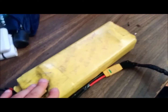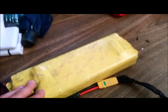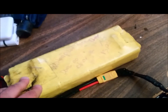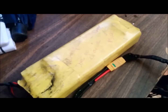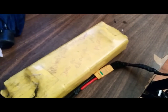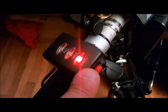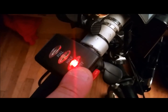I call this my Sunday battery because if you just go around the block or do something very easy, it's kind of light and I can just put it in the bag and ride around with it. Since this is a 36 volt battery and this is a 48 volt display, you can see that it's only showing one bar — it's showing empty.